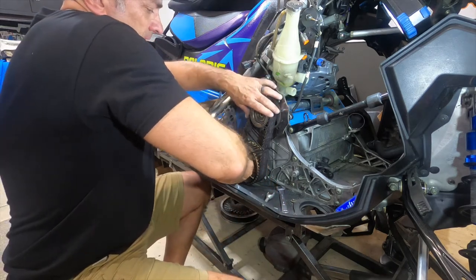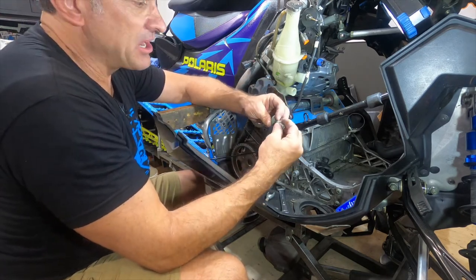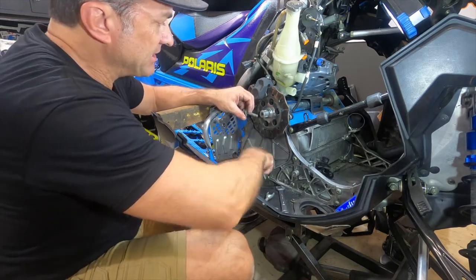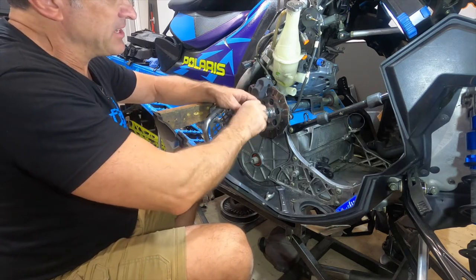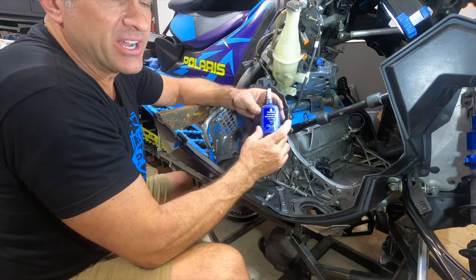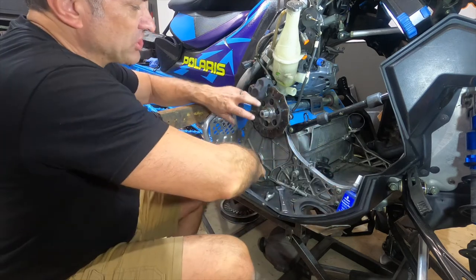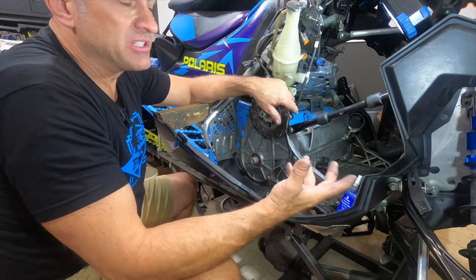A couple of little tricks: these bolts are usually put on with Loctite that gets sticky on the threads of the jack shaft and drive shaft. You want to clean out all the old Loctite so you have clean threads going in, otherwise it's going to mess up your torque reading. This is torqued down to about 43 foot-pounds on both the upper and the lower bolt, and put some fresh blue Loctite on it. The first time it's going to be a little tricky — it's nice to have two hands, one person holding the pulleys, maybe one rotating a little bit to help get them lined up. Once you've done it a few times, it's actually fairly simple.